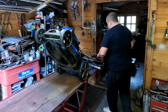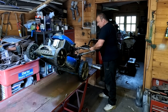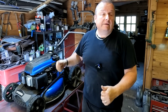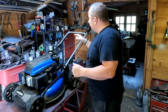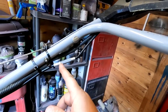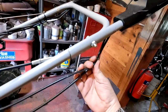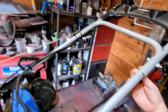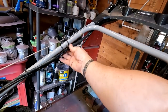Just cleared up that mess underneath there. We can put this back up onto its wheels now — just undo my bungee and bring it up. We're probably going to have to adjust the gear selector cable, because I did notice when it was in fourth gear the belt was still quite slack. What that means is you normally have to elongate the adjuster. Also, I've realized these cables here go underneath, but I think they're supposed to come along the top there, so I'll have to undo the handle and poke them through so they're on top.